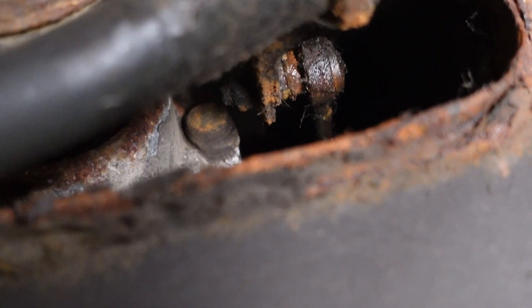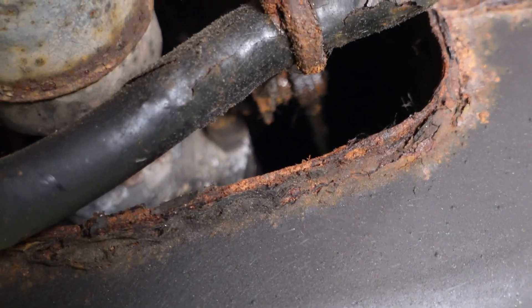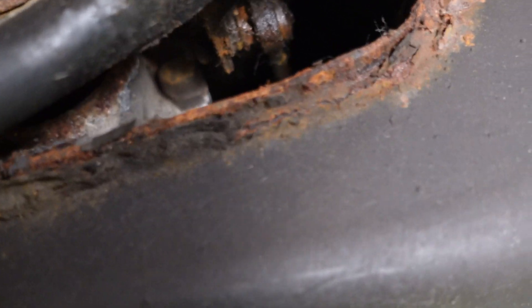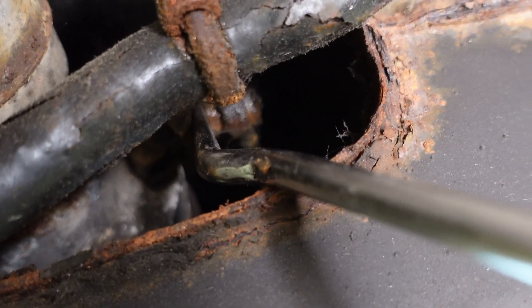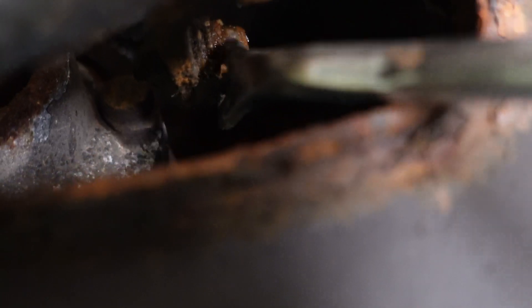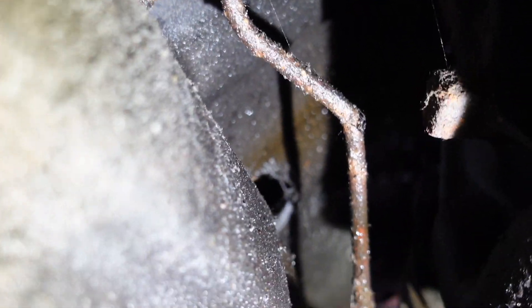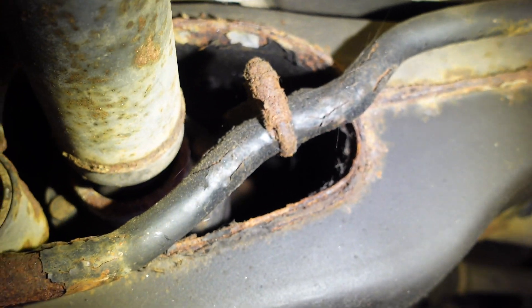The next thing we're going to tangle with is this SLS proportioning valve. It's got a rod that attaches to the sway bar, and like I said before, that's what regulates pressure to the rear SLS shocks. What I want to do is detach that rod because it goes to the chassis. You can get up there with your trim tool. I popped it off — this is the SLS proportioning valve. That rod attaches to the sway bar, and I went up in there and unhooked it with a trim tool. See how that rod is dangling? That's how that's done.